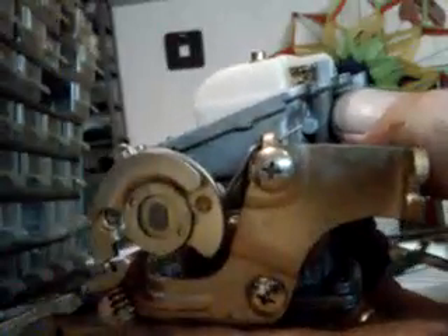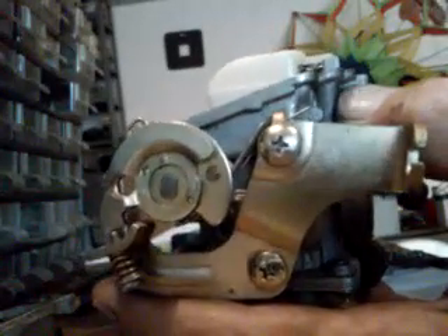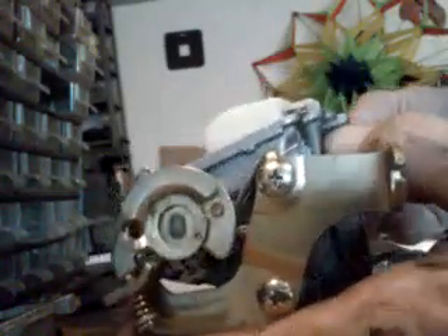When you're checking your float, I always have my carburetor open. I'll put an extra piece of fuel line on there — I use about the same one for every carb. You can blow through it with about as much pressure as you can put in your mouth, probably about 10 pounds of pressure. The carb's only going to take about three or four. So if you can't blow through it, that should be good. Then flip it upside down and you'll hear that air come through. For all ordinary purposes that should seal off once it gets gas to it, so we should be good.